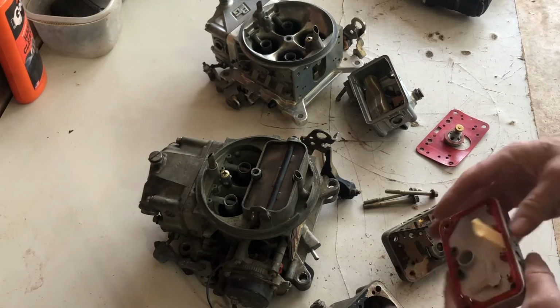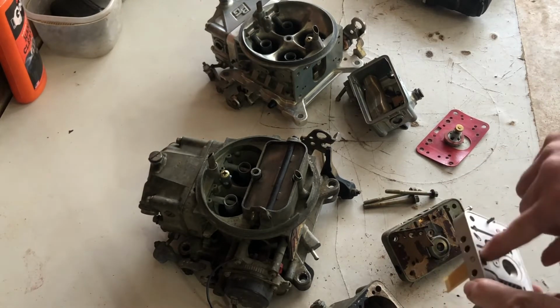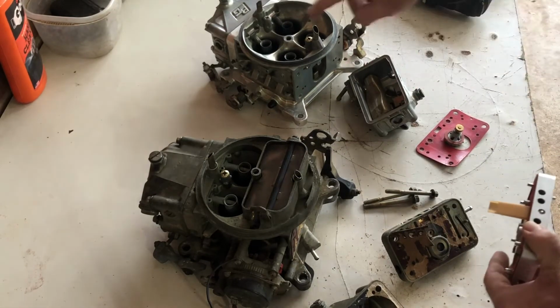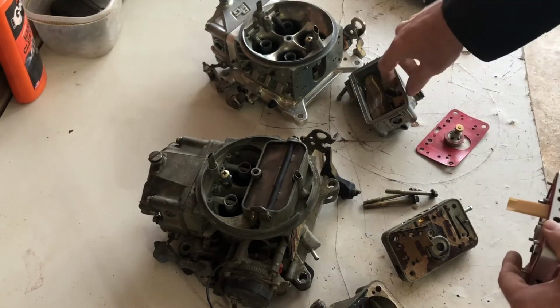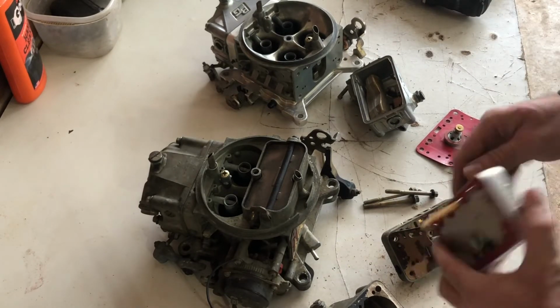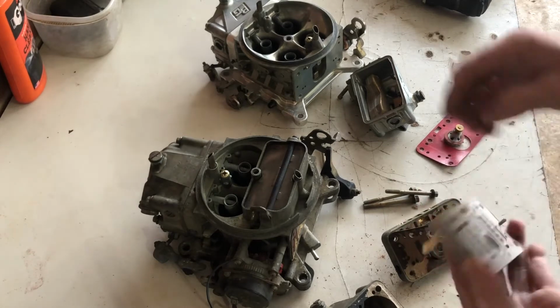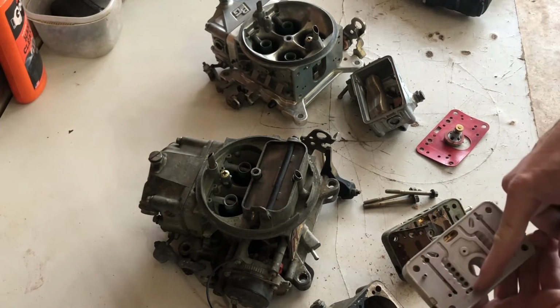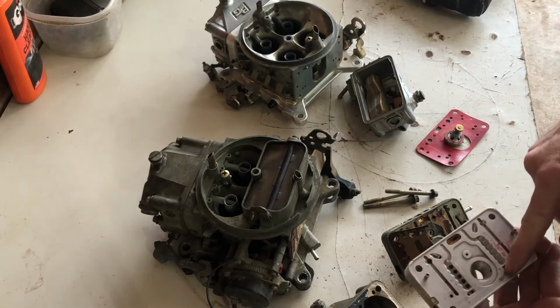So this is called the vent whistle. So the vent comes in here. This just puts what's coming through the vent into the fuel bowl. And of course we have the jets. So you can kind of see that the jets feed these main channels, and these channel restrictors go in at an angle that also feed the main channel.